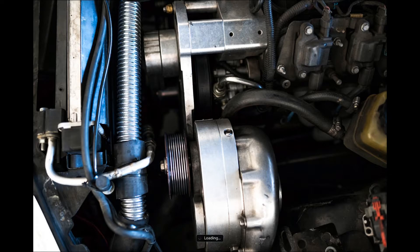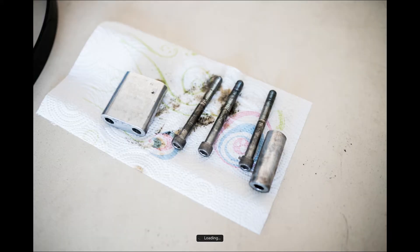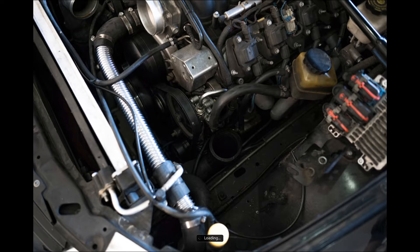There are also bracing pieces — I guess they're like supports — that hold the upper part. You're going to want to take those off: two pieces, three bolts, using an allen key. One bolt goes through here and the other two go through there. Then remove the upper intake piping that goes into the throttle body, because you need access to the tensioner to get the belt off and want all that space open.